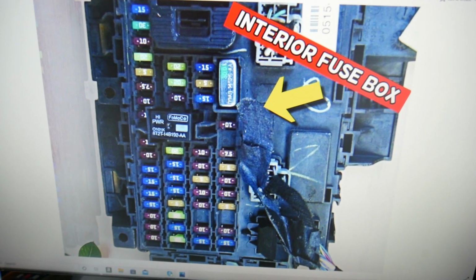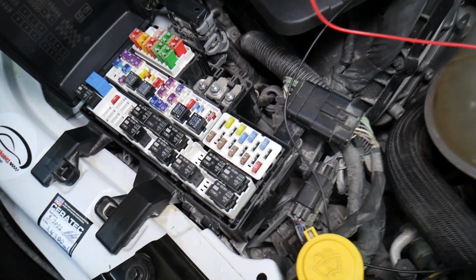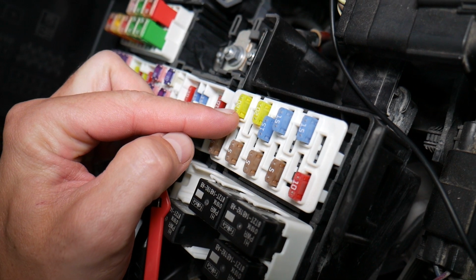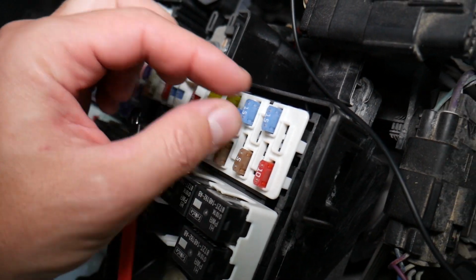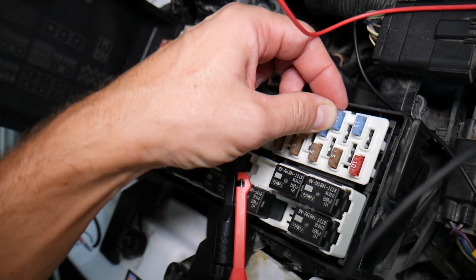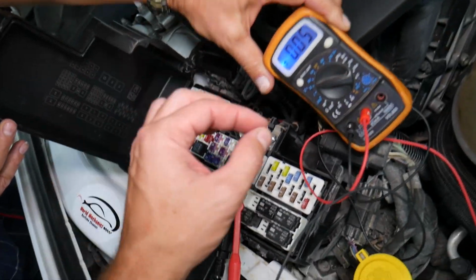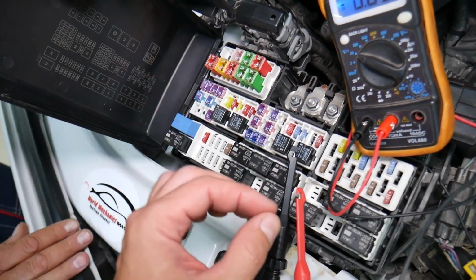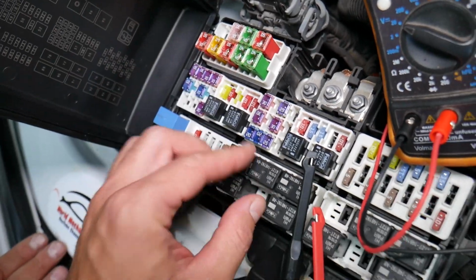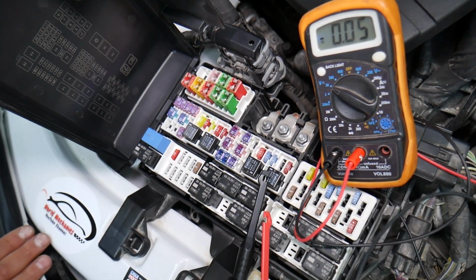Before we continue, let's explain quickly why it's always a good idea to test fuses and relays. So let me explain why it's super important guys to test fuses. Fuses, not often you can see if they're burnt or they're good. Sometimes they may seem perfectly fine, you think it's a good fuse, you put it back in and you end up spending money and time on parts and problems that do not exist guys, when all you had to do, test your fuse, find out it's bad, replace it, fix your problem. So we will have a video on how to test a fuse, different kinds of fuses, and how to test relays guys. We're going to put the link in the description of the video below specifically to that video.